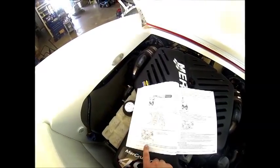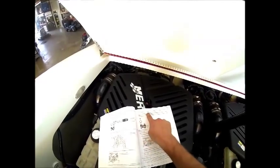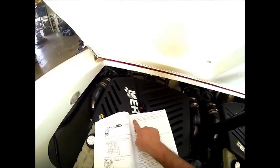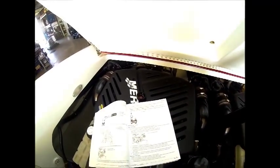So now we're going to pull the lanyard stop switch if it's equipped, and we're going to crank the engine over slightly to purge any water trapped in the seawater pump, but we're not going to allow the engine to start. And once that's done, we're going to remove the air pump, secure it back to its location, and we're going to leave the green indicators purged while we're doing the remainder of our work, just to ensure that all the water is drained out of the system.